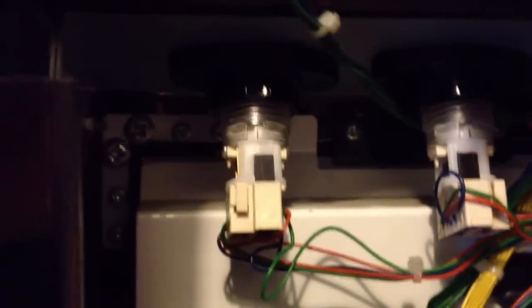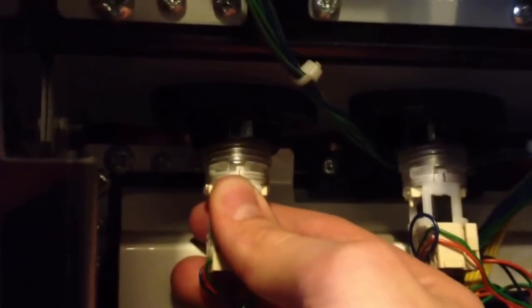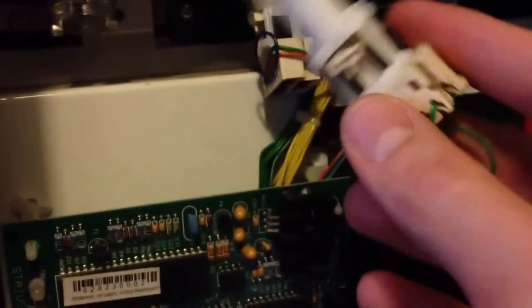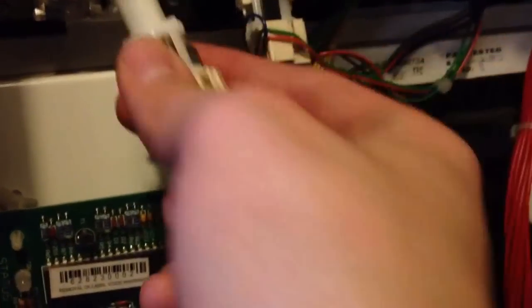Make a little note somehow, and then this will just pull away. You may need to remove the buttons to take it off. I'll show you exactly how you remove a button — quite simple really. With the old machines or the Horizon cabinet, you'd have to twist it sideways. With these ones, you just pull them down and that's what you have. Obviously you've got your micro switch in there. To put it back in, just a simple case of pushing it back up, make sure everything's all nice and snug and secure, and just test your button before closing it back up.